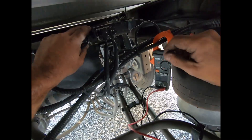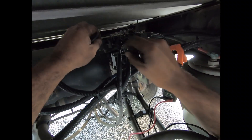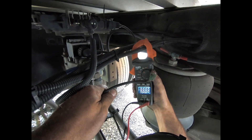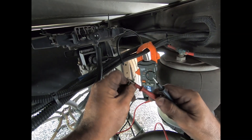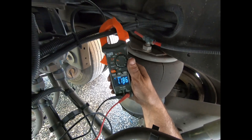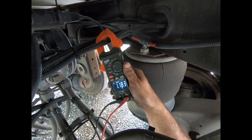Now let's test the actual sensor on the trailer. I'll start at the extension cable that plugs into the sensor to test everything at once — if I get a good resistance reading here, I know the sensor is good because the signal has to go through the extension cable first. Pop this connector off YE2, plug in the extension cable adapter, fire up the meter on resistance, and we get 1,190 ohms — just about the same as a brand new sensor. So the sensor is ohming out good and we move on to the next test.